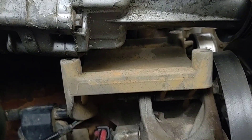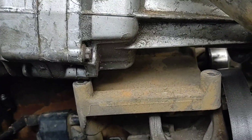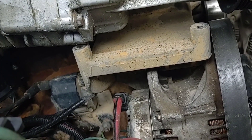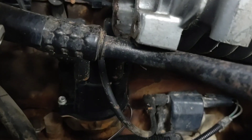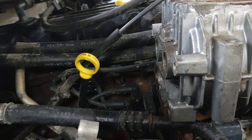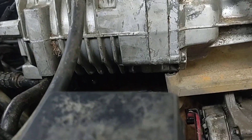I think I'll be able to use those four bolts and then have a plate just go straight back. There's one hole in the center up front, and then there's two in the back. I'm sure it's going to take some work, but it's not going to be the end of the world. Something I might look into for a little more clearance is to see if they make a crab cap for these, because that would put the terminals out even lower and make it easier. Because I think once this is out of the way, that's what it's going to hit next — or it's going to be really close without having to get a really thick plate cut out somehow so it has clearance down there.